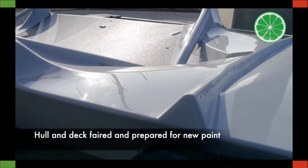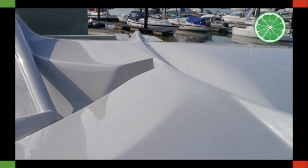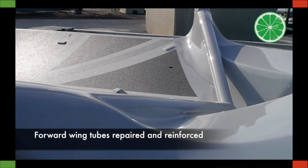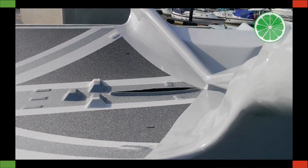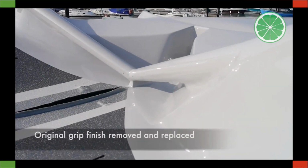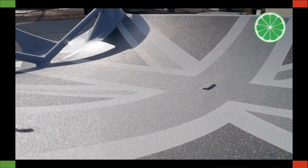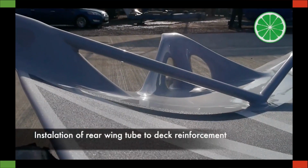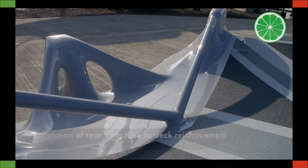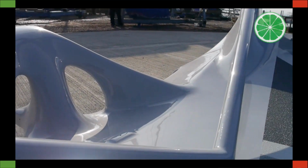One of the things we find across the board with the Durepox is that it seems to be really tolerant. People use less thinners, bigger fluid tips in their guns, get lots of paint on, lots of thickness. Other people use more thinners, like you just heard, and put it on as a thinner coating. And whatever anyone does with it always seems to go off okay. It doesn't solvent trap and things like that. It seems to be pretty robust. Have you found much the same around the workshop when you're using it for different purposes?